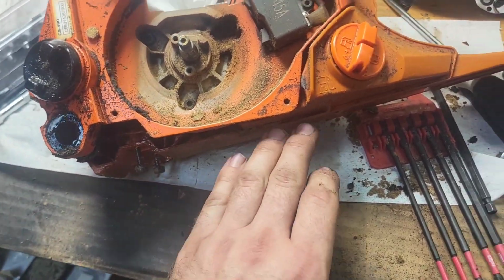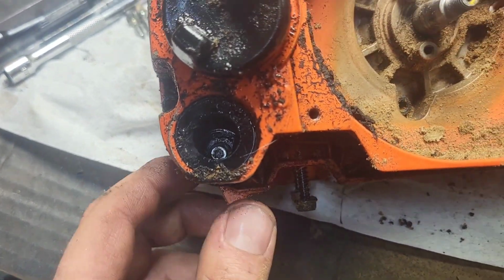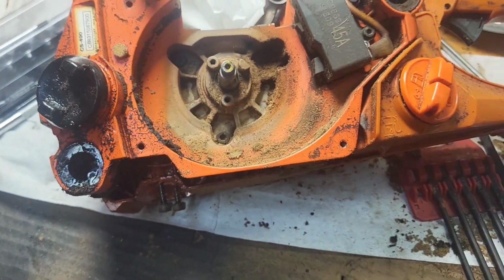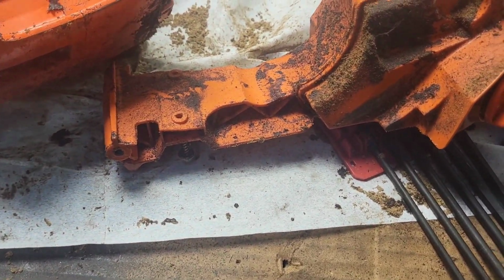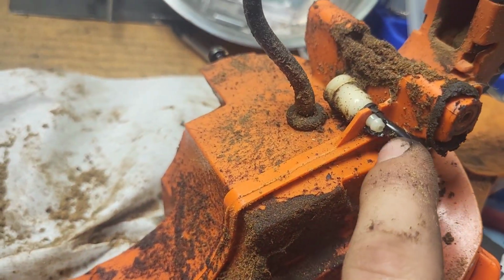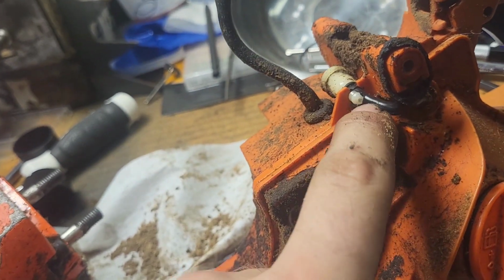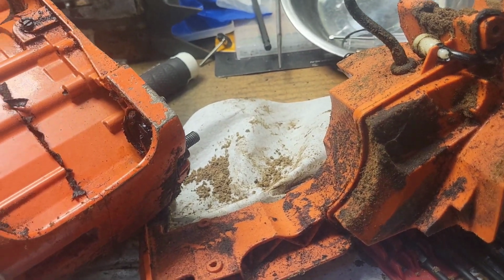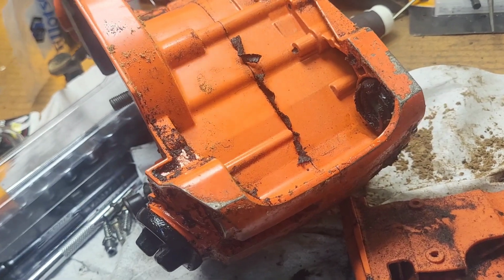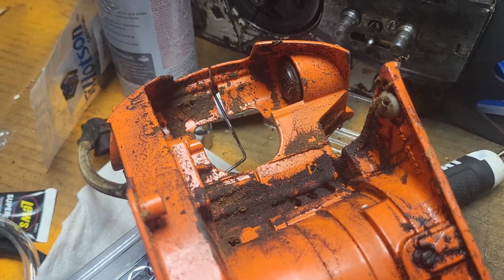But right now I'm still working on getting the fuel tank rear handle assembly off. And you can see why I got these, I'm replacing these isolators too. They're shot. Just the view of more filth. Also going to have to replace this vent line in the tank, but that'll be nice to do nice and easy while that fuel tank is off of here. Fuel tank wasn't terrible to remove. There's some caps in the isolators that pop out and just gives you access to everything. But yeah, it is pretty nasty.